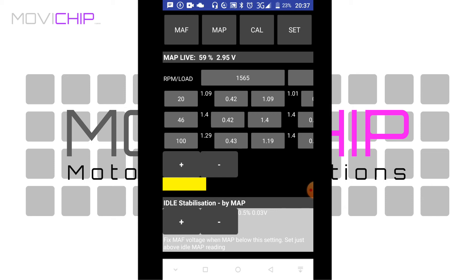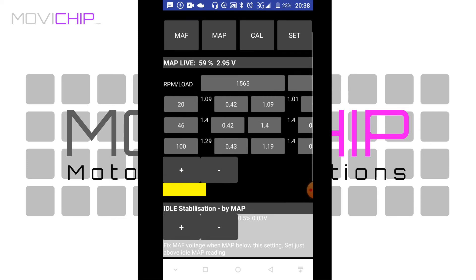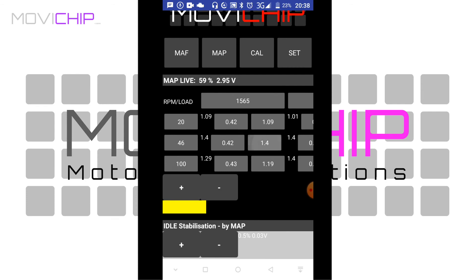Assuming we've been driving for longer than five minutes and we are using the auto-tune function — it's optional — after five minutes it will start to automatically adjust the dynamic multipliers in black to achieve the AFR we've set. If it's the first time using the product, the numbers in the black background may be very different from the numbers in the right column — that's entirely normal, it just gives us a ballpark starting point. Go out for a drive for say 10 minutes, come back into the pits without switching the engine off, open the app, and look at how the numbers in black compare to the numbers on the right. If the dynamic number has gone from 1.09 to 1.19, you can safely assume you need to increase the fixed multiplier by about 10 points.